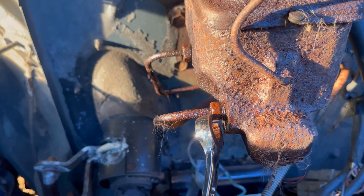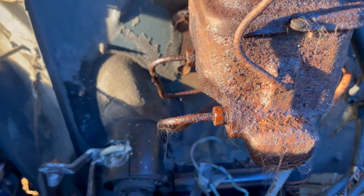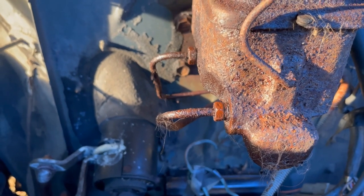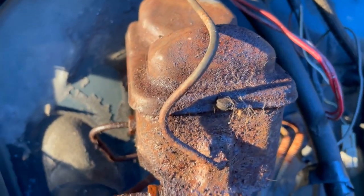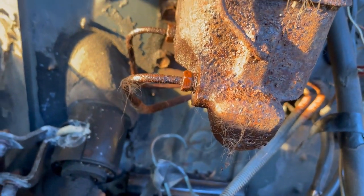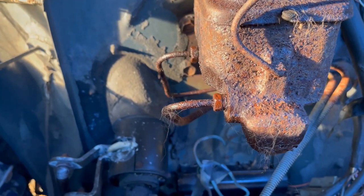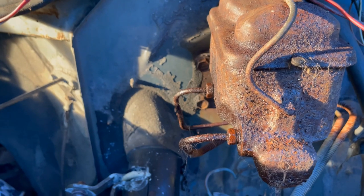Don't heat the line - aim the heat at the fitting. Get the fitting not red hot but you'll notice it. I'll show you, and then shut the heat off and quickly go to it and see if you can break it free. I'm not sure if it's going to work. I hope it does because I don't feel like changing these lines - they only run down to the junction block, so you don't go that far. But these are the factory lines; I'd like to keep them. I'm going to use propane rather than MAP gas - MAP gas will work but it's pretty hot, so I'll start with propane.